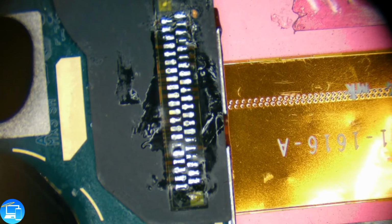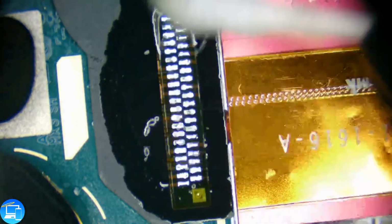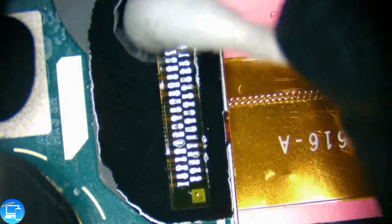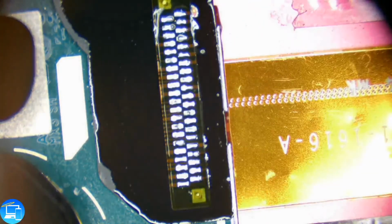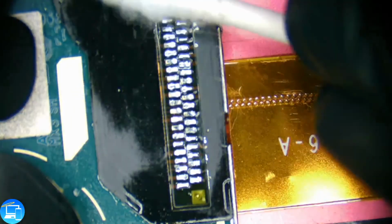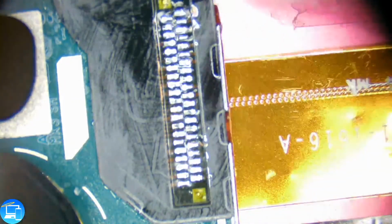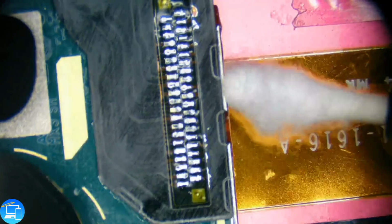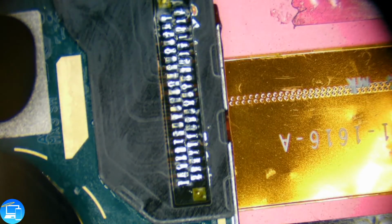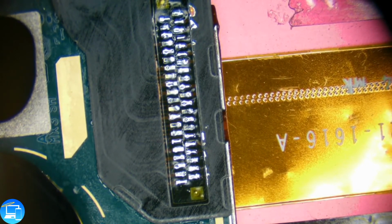But at least in this video, you've seen that we were able to diagnose what exactly was going on here. We were able to isolate that by testing the battery. The battery wasn't the issue here. The reason why this whole guy wouldn't charge was the actual charge port had gone bad. The logic board was fine, thankfully. I don't like doing logic board repairs onto iPod Touches just because they're not really cost effective. While this is a little bit of micro soldering, it doesn't entail the same amount of troubleshooting as a standard board repair on like an iPhone or an iPad.